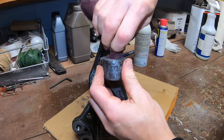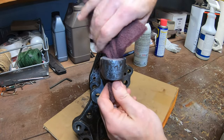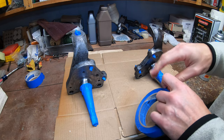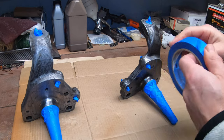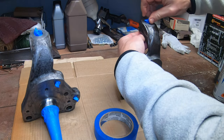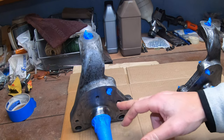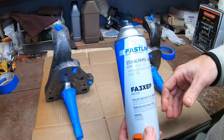One more detail: I want to clean out the interface where the ball joint is going to go. I'm just going to take a Scotch-Brite pad, stuff it down in that hole, and work it back and forth to get as much surface rust, dirt, debris, and scale out of there. Then I gave these a really good thorough wipe-down with wax and grease remover. I'm making simple little plugs out of painter's tape to keep paint out of the threaded holes I just tapped, the ball joint holes, and I'm taping off the spindle shaft where the bearing rides.